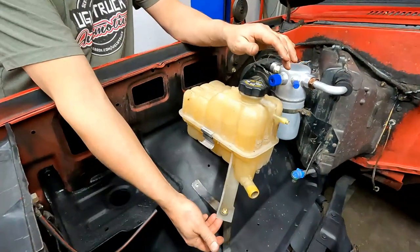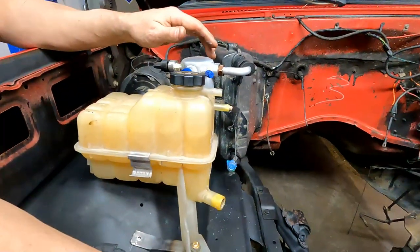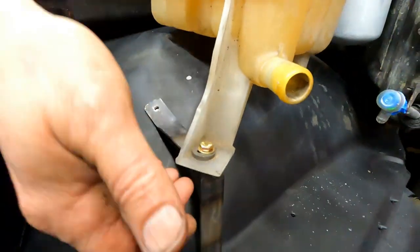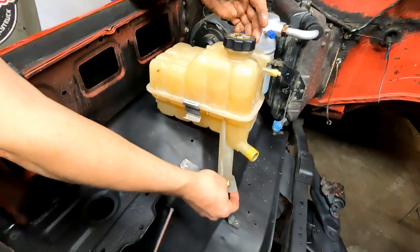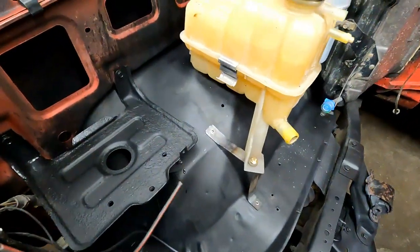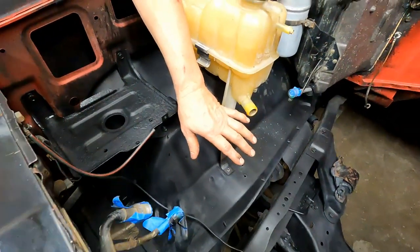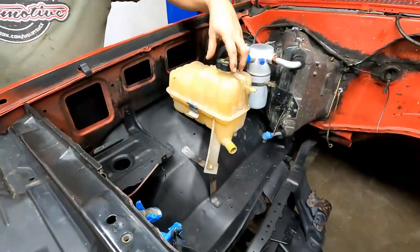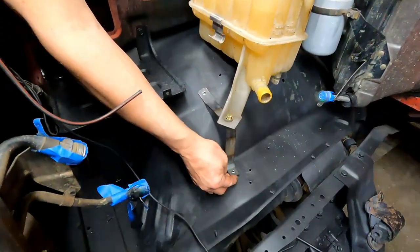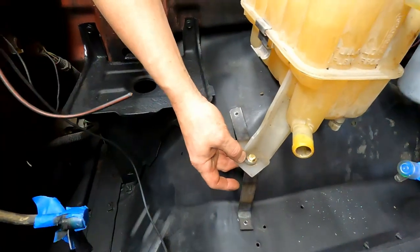So when I bent this bracket, I got it a little short, but I can build that up underneath it with either another piece of metal or a washer or whatever and bring it up just a little bit. But it's real close. If there were a couple washers underneath that, you'd never know. If it was too long, you can't really fix that. So if it's too short, that's better. It gives you a little bit of adjustment. Or you could put the washers underneath your brackets at the fender too, but I'd just put them underneath this one. Yeah, hide them a little bit better.